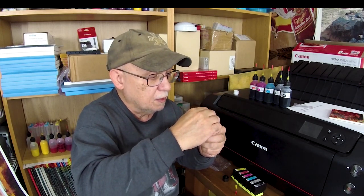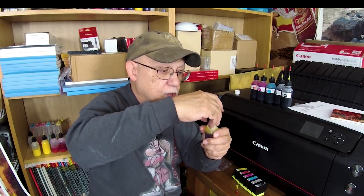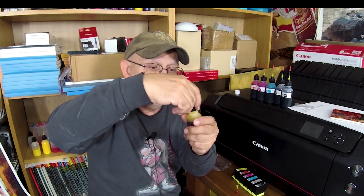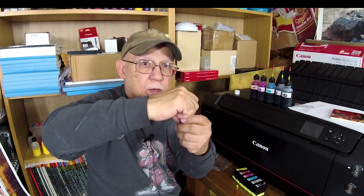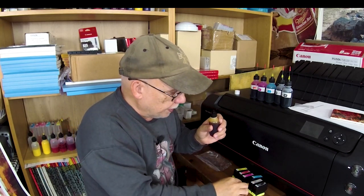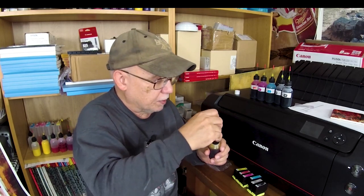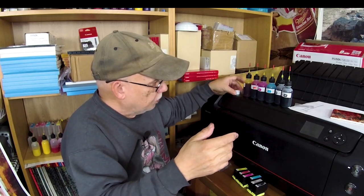Use your finger to make sure the edges are facing downward. Now the important part — so that you don't have any leaks when refilling your cartridges, install this perfectly. It's a kind of a pressure fit, so we're going to screw it in and when it gets to the very bottom give it about another quarter turn. Make sure it is nice and tight. I've had people complain about ink falling everywhere — that's because they did not install the cap correctly. Then we install our needle onto the luer lock and we're ready to go.